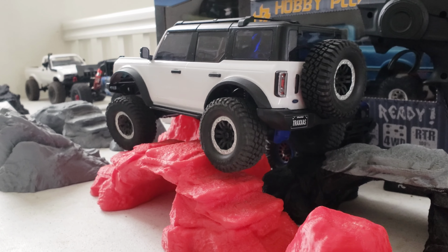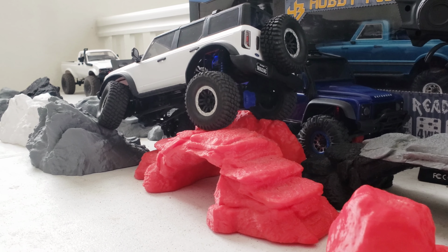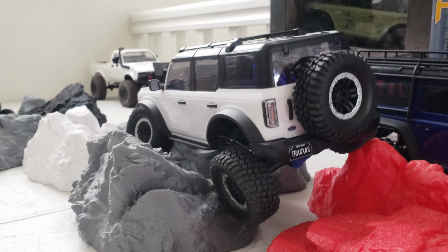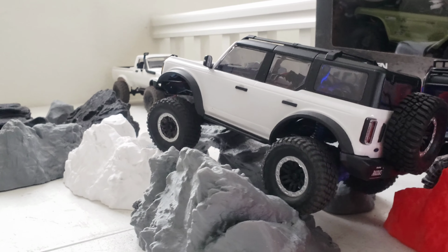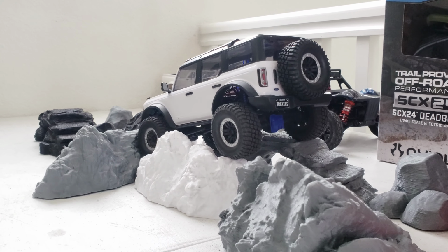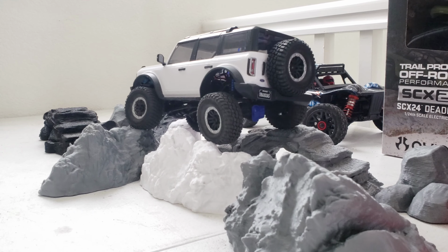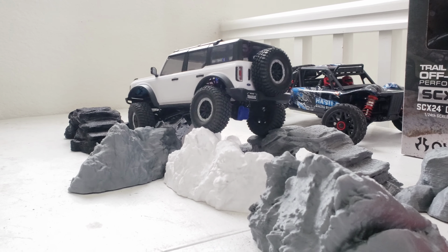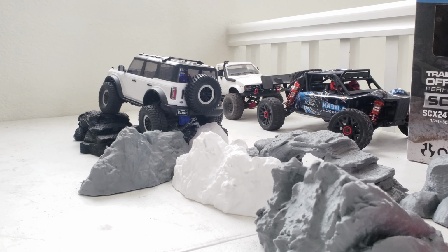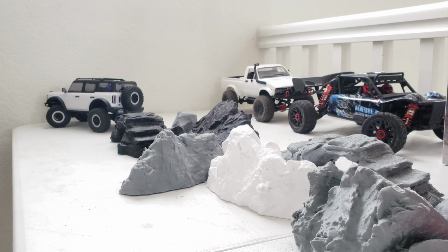But as you can tell, it crawls pretty nicely and really low. But when you start, oh, see, it's kind of jumpy with the speed. But when you start giving it some speed to crawl, you can tell there's the cogging. Don't mind the squeaky sounds, it's just the tires rubbing, and I am crawling on plastic. It's not bad, it's doable, it's crawlable, you could use it this way. Some people might not mind it because they won't crawl on any obstacles that are going to bind it up, so it'll be fine. But as you can tell, there is some cogging going on, and a little bit of jittering.